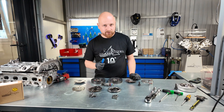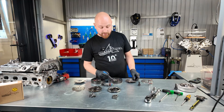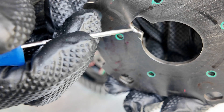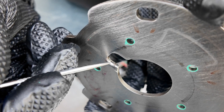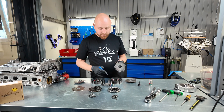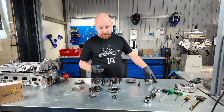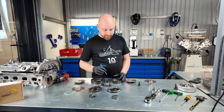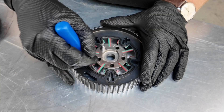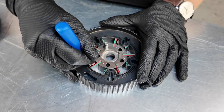The distinctive rattling noise that occurs during startup is primarily caused by a malfunction in the locking mechanism — specifically this plunger right here. Over time, the locking pocket, this specific area right here, gradually wears out. Do you notice this distinct polishing in this particular spot? That is exactly wear and tear. At that stage, the piston fails to latch correctly and doesn't maintain the starting position during engine ignition. When the oil chambers are completely empty, the rotor starts to swing back and forth rapidly, producing a distinct and noticeable rattling sound.